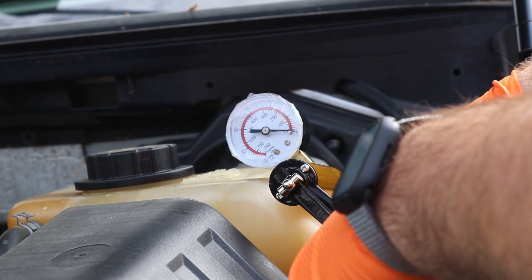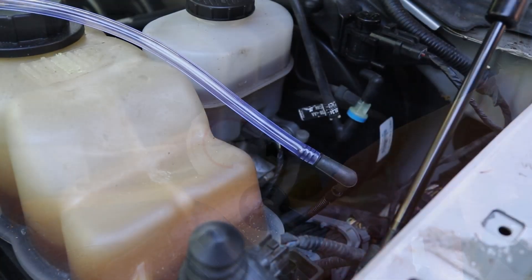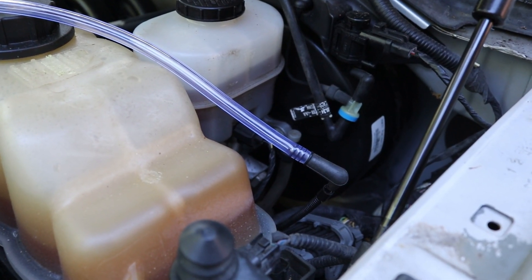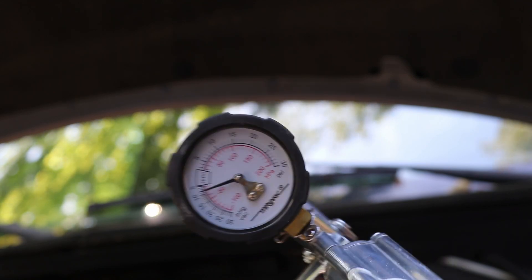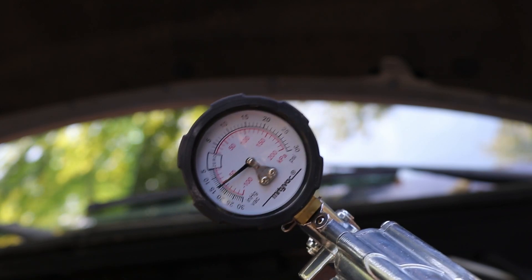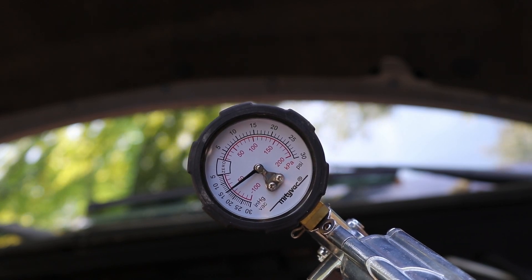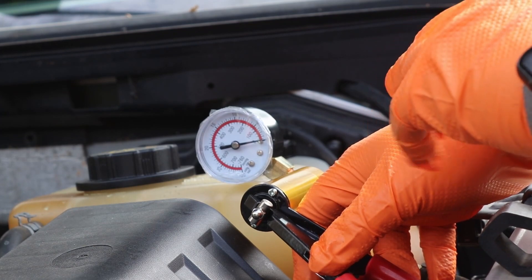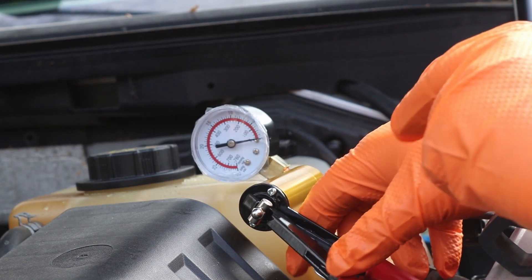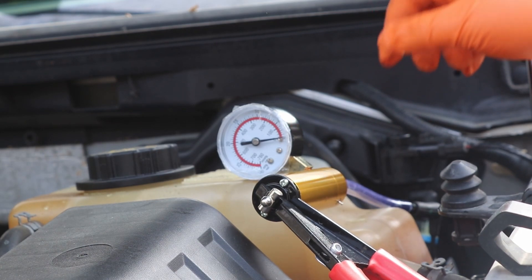That's not a good sign — it's not pumping up at all and we're not getting any vacuum. Now if your IWE and vacuum lines are good, this is what it'll look like: hook up the vacuum gauge, pump it up, and as you can see it can hold a vacuum. You'd want to hold this for a good minute or so just to make sure, but this one is holding just fine. To be safe, we'll go and directly connect to the IWE and make sure it can hold a vacuum — if it can, then we've narrowed it down to that vacuum tube needing replacement.